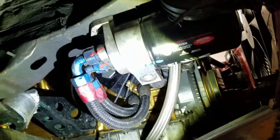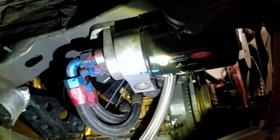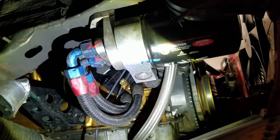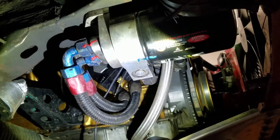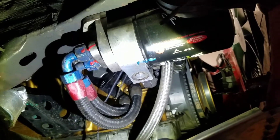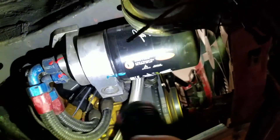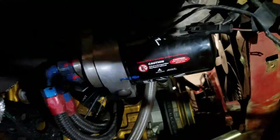Off the adapter here we go to my oil cooler, which is a little undersized — I'm going to go with something a little bigger for next season. I was having some oil temp issues; it would only really creep up when I was doing back-to-back runs, but it definitely showed me that I'm going to have to go a little bigger with the cooler. But yeah, I'll put part numbers for most of the stuff here.